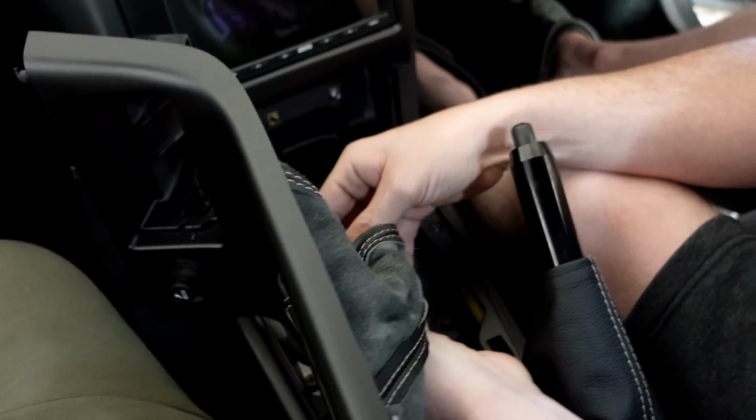So this is 400 degrees for how long? 10 minutes? 15. 15 minutes. So we just have to watch this inside. When the powder turns glossy, that's when you know the part's at 400 degrees. That's when you start your timer. Yep. Easy enough.